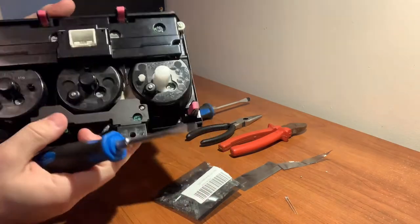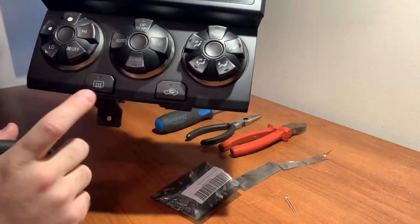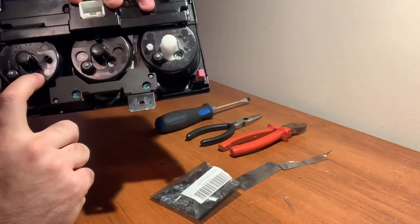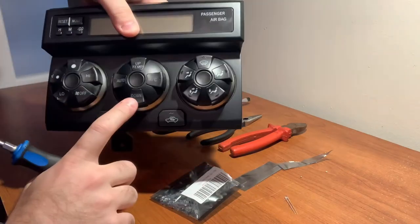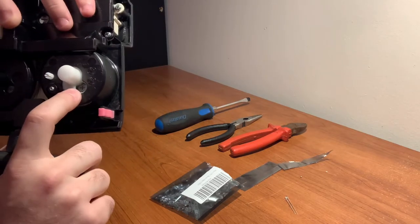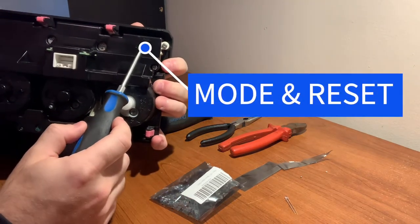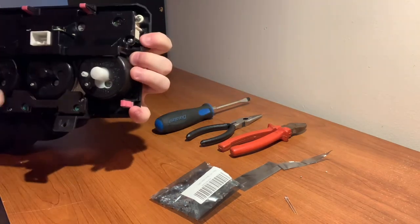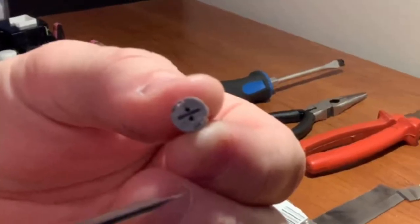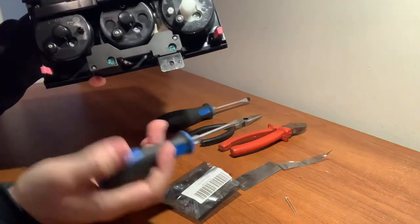These two down here — one is for the AC circulation and the defrost is on this side. For this knob it's this bulb — see that gray one in there. The middle one is what you're trying to do, and there's another gray one, same for the last gray one. For the LCD panel you have one and two, and then this one over here is for your seat belt indicator and safety indicators. Take one, you'll see a little notch — put the screwdriver in there, give it a slight turn, and pop it out so it falls into your hand.